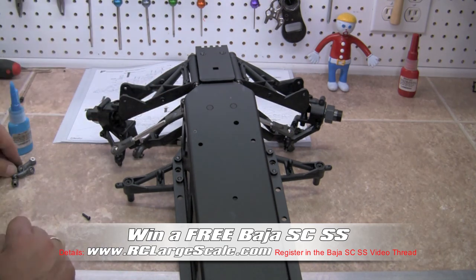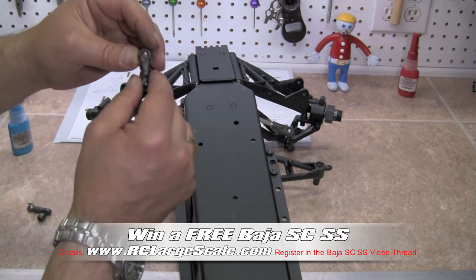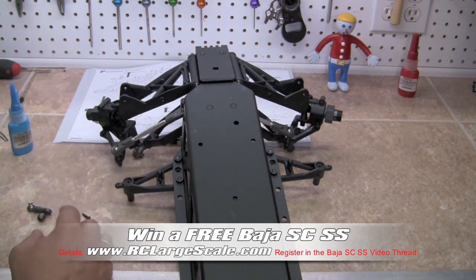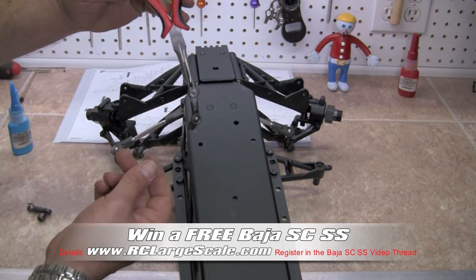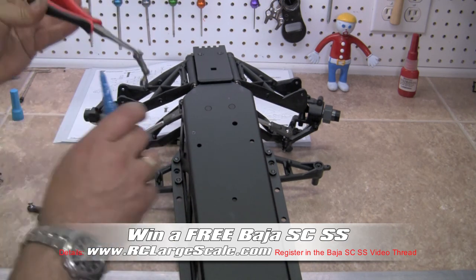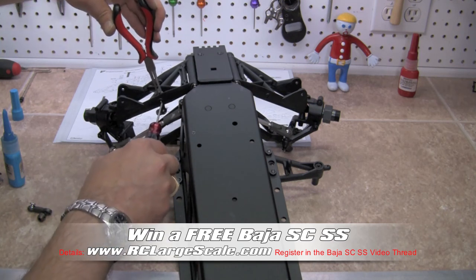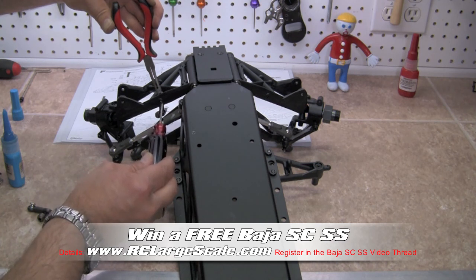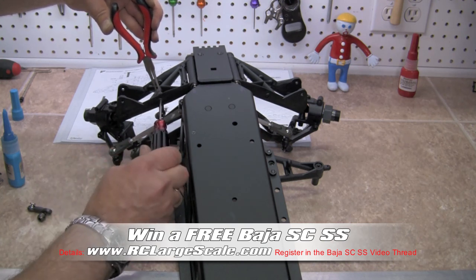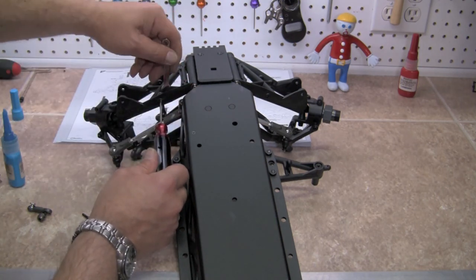You're going to push it most of the way through. Now we're going to take one of our links and, as it's upside down, we're going to let that dangle down as we insert it. I'm going to use a pair of needle nose pliers here to hold on to this, put a little Loctite on, and screw that in. Once you get it tight, go ahead and use that little 7mm wrench that came in your kit — it fits right over that ball — and snug them down real good.